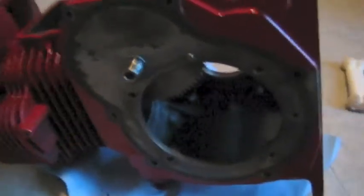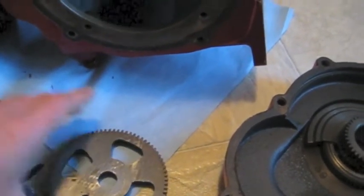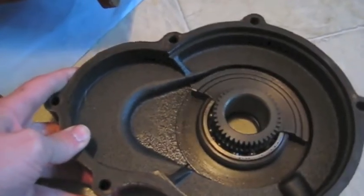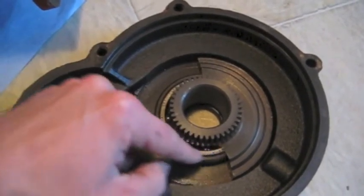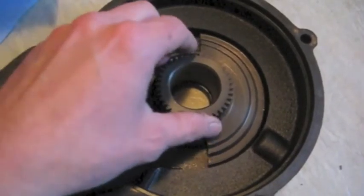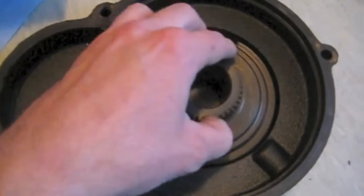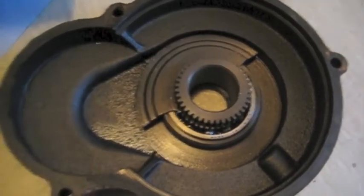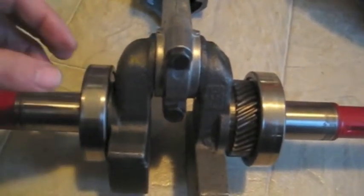On the side of the engine there are two covers on both sides — that's where the timing is set. There are two big gears and another gear, and that's how you set your timing. I really like this little cast iron engine; they don't build things like this anymore. It's got a nice big bearing here and a counterbalance weight for the crankshaft to help with vibration. It's pretty clean — I don't hear anything when I spin it. The crankshaft has some big bearings on it too, and I'm probably going to replace those because they make a little noise when I spin them.